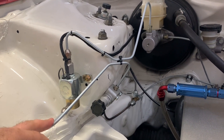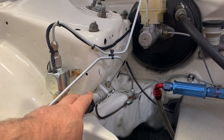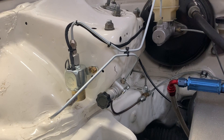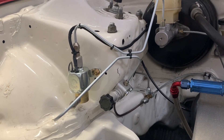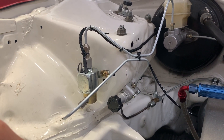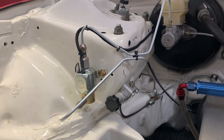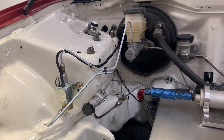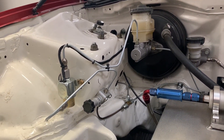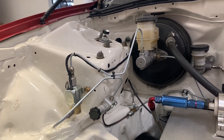So that's how that works, and then we've got a brake bias valve which allows us to dial more or less braking on the front as needed. We've got some Wilwood Superlites with 320mm two-piece rotors on the front, which do a super good job of stopping. We're using Hawk black brake pads, which just take a couple of stops to get going, but then work super well on the street. We've had it on the track a couple of times and haven't been able to find their limit yet.